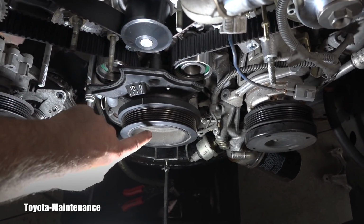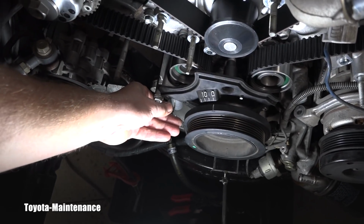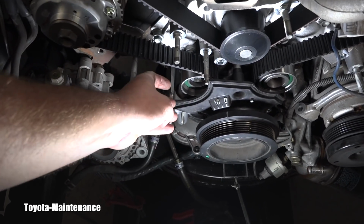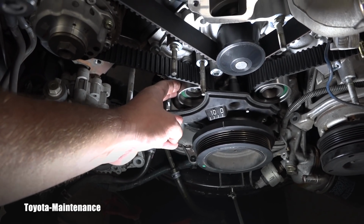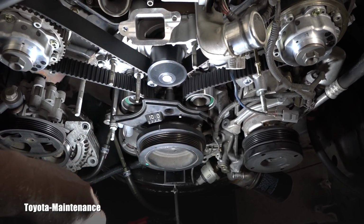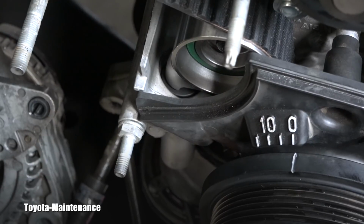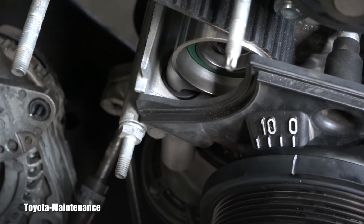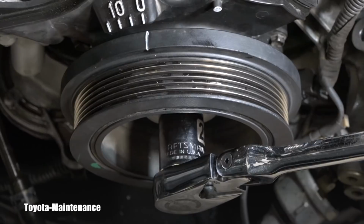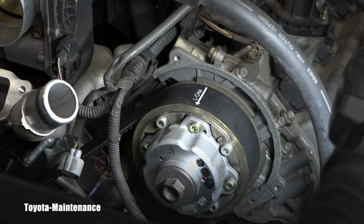All the bolts, put them in. I will install the harmonic balancer. I will pull the pin, right, which is holding that hydraulic tensioner. I will pull it out. The tensioner will pull correct tension on number 1, and I will do my 1 rotation, which will confirm that everything is okay. Those 2 bolts on the bottom of that hydraulic tensioner, those 12 millimeters, are supposed to be torqued to 26 Newton meters. That harmonic balancer bolt is supposed to be torqued to 245 Newton meters.